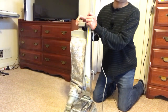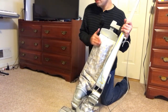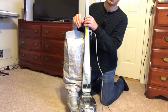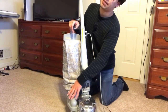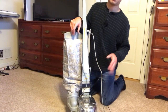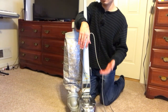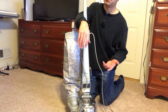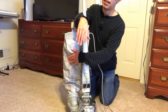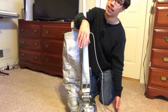One other area that could be a problem is the exhaust port right here. Just the same as the front, you want to make sure that everything that is supposed to go on here — whether it's a bag assembly, shampoo tank, whatever — is properly attached. A common thing I've heard is people will convert to the shampooer to shampoo their carpet and then put it all back together, but they haven't put the bag on properly. So when they go to use it again to vacuum normally, it doesn't turn on and they're kind of panicked.